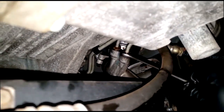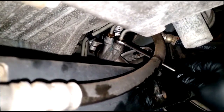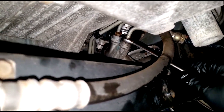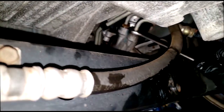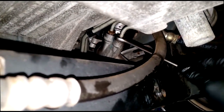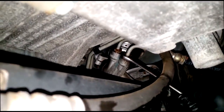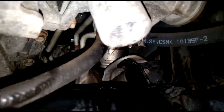I can see my 18mm wrench is right on it. What's just below 18 - probably 17? A 17 is not gonna get on there, maybe 11/16 standard. I can't remember, but I might have to go down one notch. Even if I go down on the wrench size it's not gonna fit the head properly. As I try to turn it I feel like I'm about to round it off.